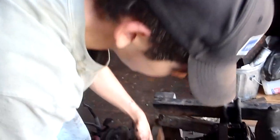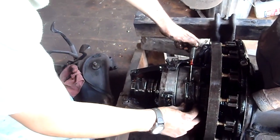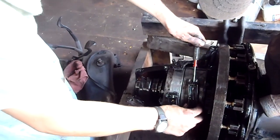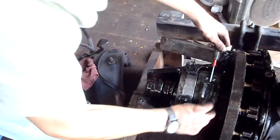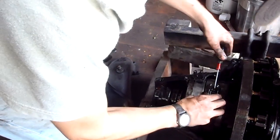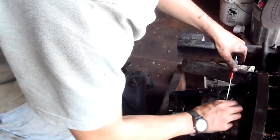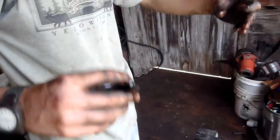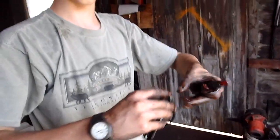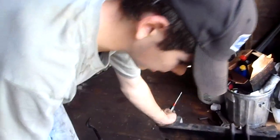We're here pulling the bands out of the transmission. This one has a clip on it, so we just get the clip and try to work it loose. There it goes. That's what the pedal holds onto — when you squeeze it, it rotates and squeezes the transmission drum to get it into gear.